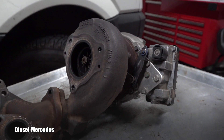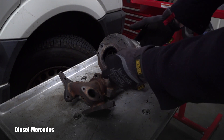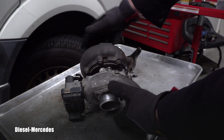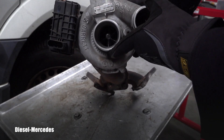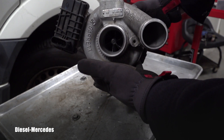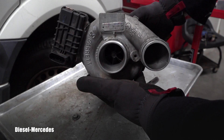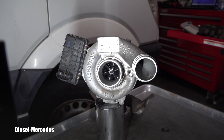This video is actually to show you the other side, which is damaged. There is zero play in the turbo — if I grab the other side, there is absolutely no play. It spins really nicely and easily. I put the camcorder on the tripod so you don't suffer from my shaky hands. This is the compressor side, sometimes called the cold side — this is where the air inlet comes to the compressor wheel.